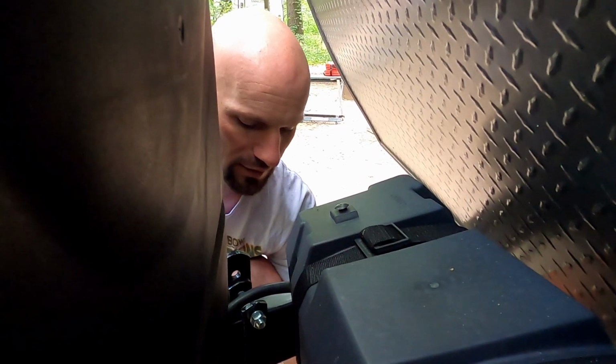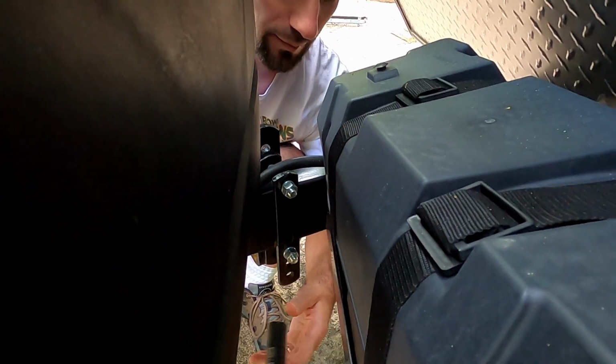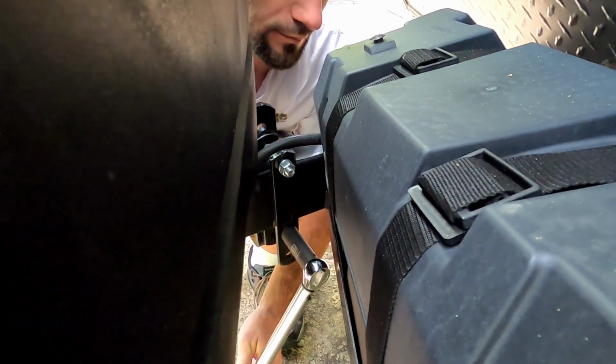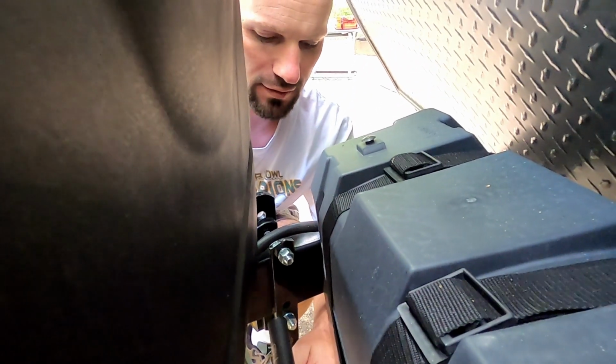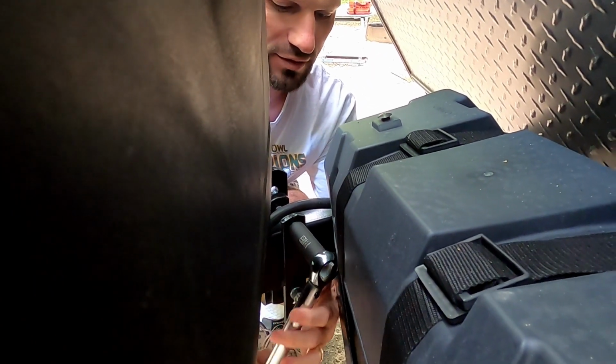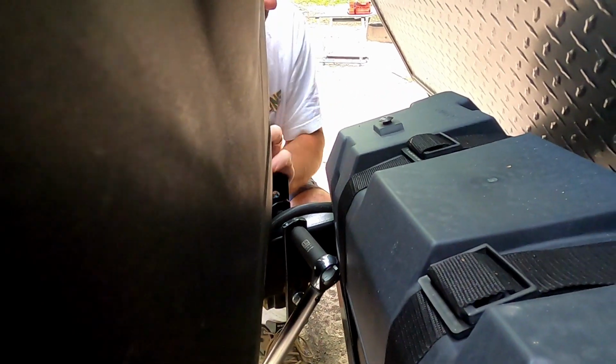The ones on the back can be a little bit tricky to get to with the torque wrench, but if you put them in there at the right angle, you can get to them. The best way to get at the bolts on the back side to tighten these is from the bottom. So I come up underneath here and do them this way. And I will say, out of all the nuts that I usually torque, these are the ones that usually turn the most. So these are really important to get.